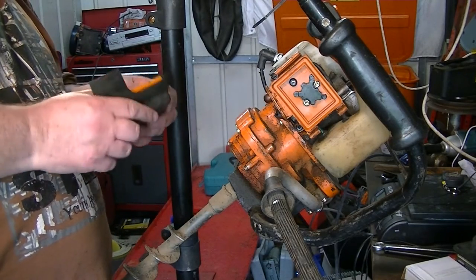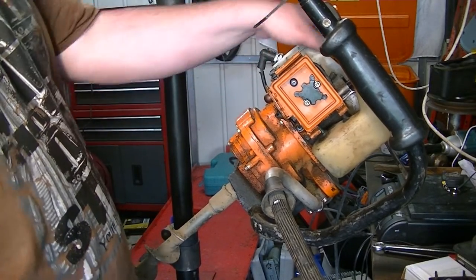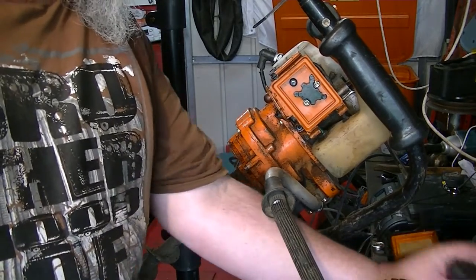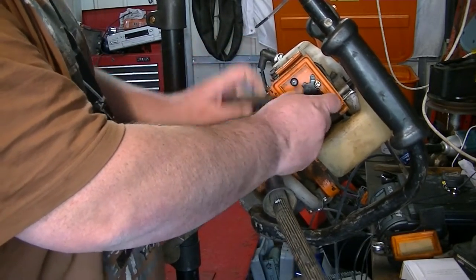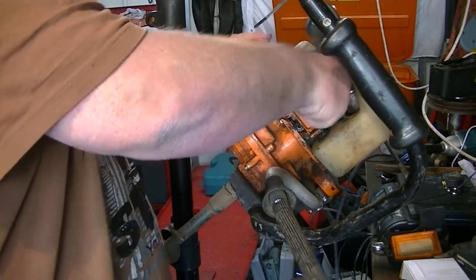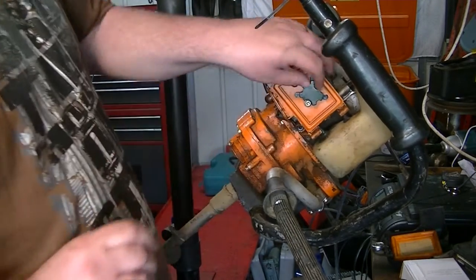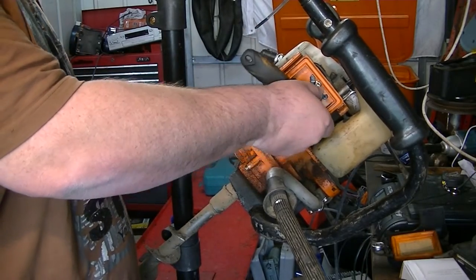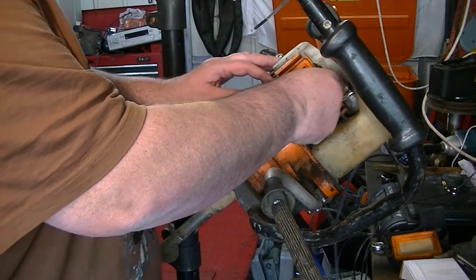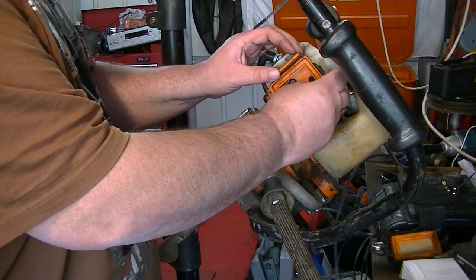This is only a backup machine. I've got the casing off because I'm doing other things to it — you wouldn't normally have to take all that off. This particular one's got a Chinese cylinder kit on it — cylinder and piston kit. According to the owner, he hasn't done it and he's owned it about 10 years. It's ex-rental so it's had a hard life. I've compression tested it and it was at 125 pounds, so that's okay.